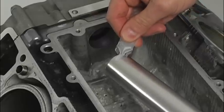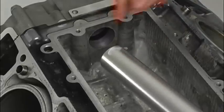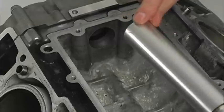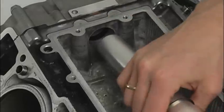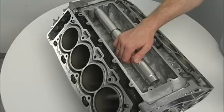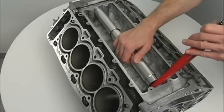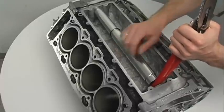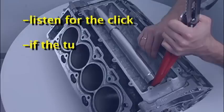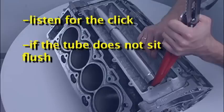Take the assembled and collapsed pipe and grease the front tube end. Offer it up to the front seal gallery, making sure that the tube sits squarely and plumb to the front of the engine before completing the next step. With a soft face pry tool, lever the tube forward until it stops against the timing cover. You will feel and hear the tube come to a stop against the timing cover, indicating a proper fit.